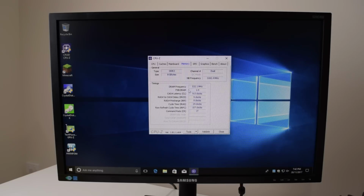So reducing the memory frequency actually did work. So maybe this is a limitation of the processor or the B85 chipset. I'll have to do a bit of online research. This is the only Haswell processor I have, but assuming it's an unlocked version, I basically assume that it supports overclocking the memory as well as the multiplier.